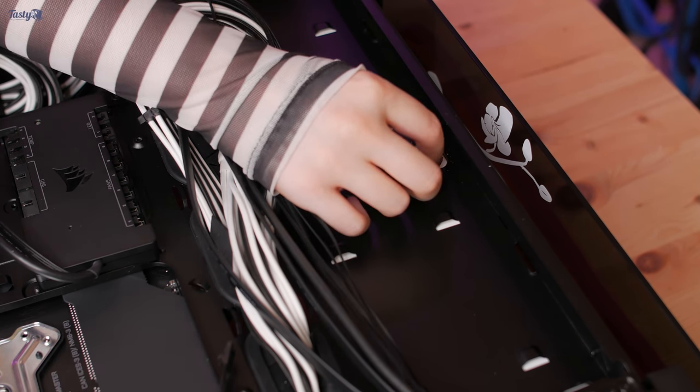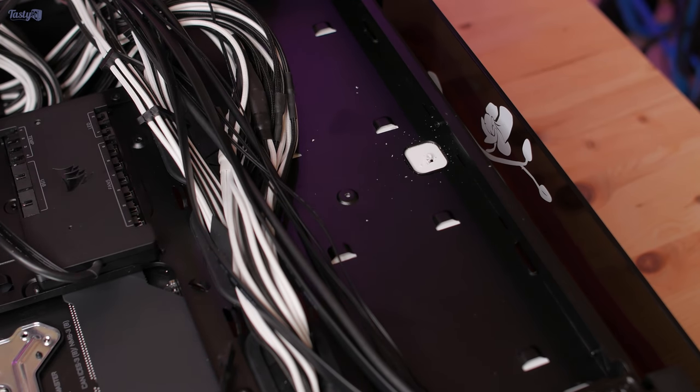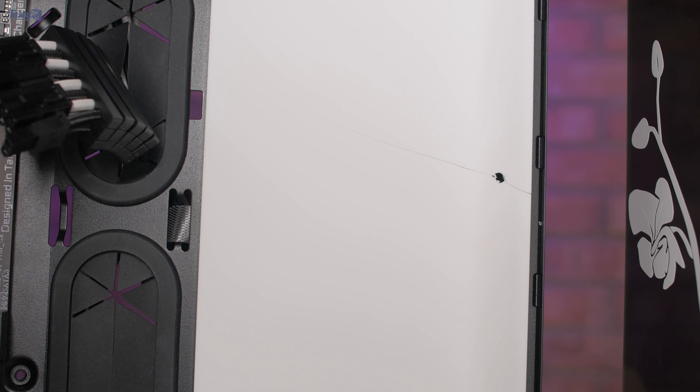Fuck. So if you think I'm taking any responsibility for this, you're wrong. This is completely your fault. Yes, you. Because firstly, okay, you should always have had something under the acrylic to stop it from snapping. Secondly, you should have applied very little pressure until the drill bit was actually spinning. And thirdly, you should have worked up the drill bit sizes instead of getting overconfident. So just a lot of schoolboy errors, if you ask me, none of which I would have made myself.